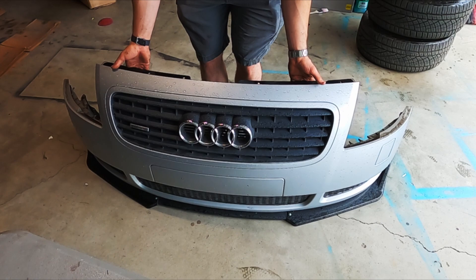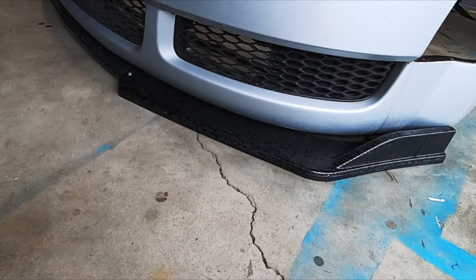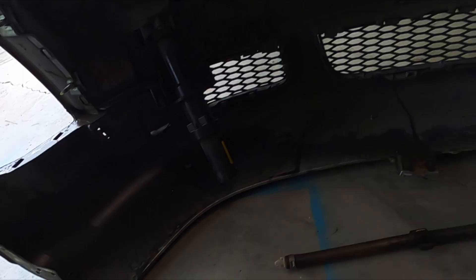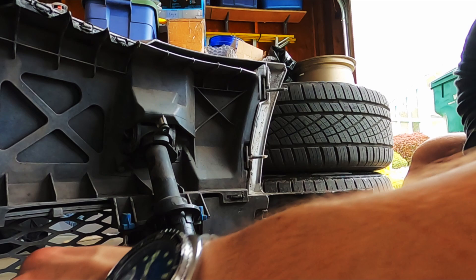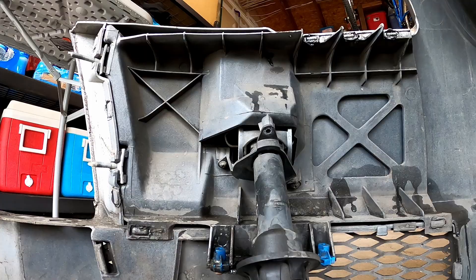If you've never seen a 225 bumper off the car, this is what it looks like. I've never taken the bumper off this car, so it's kind of cool to see it outside the vehicle. Now I removed the washer fluid modules on the back of the bumper so we have room for the intercooler piping. You can see one of these on each side — their purpose is just to pop out of the bumper and spray the headlights, though I don't think this system ever worked on my car specifically. Each one has five Phillips screws, some of which are hard to get to, but once they're all out you can just pop each one out and the hose on the bottom comes along with it.